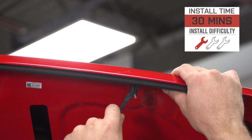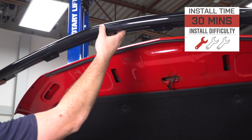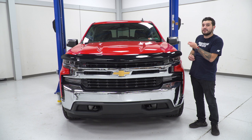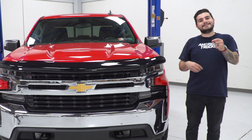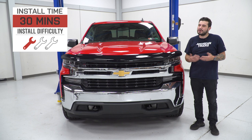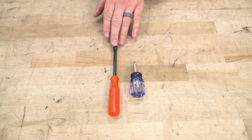Install-wise, one out of three wrenches on our difficulty meter. It's a no-drill install, direct bolt-on — very simple hand tools will get the job done. Really all you need is a panel removal tool and a Phillips head screwdriver. It's gonna use pre-existing factory clip positions underneath the hood to fasten itself on, and it's got additional clips on each side that'll be protected by a new film that comes in the kit so it doesn't come in contact physically with the paint. It'll take you about 30 minutes, maybe an hour from start to finish, probably a little bit less than that.